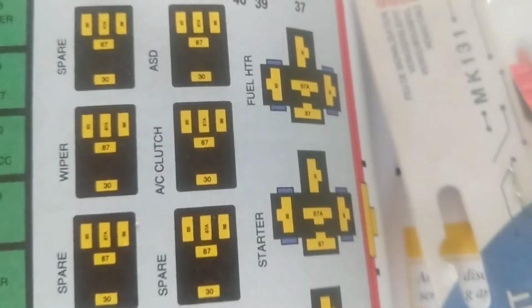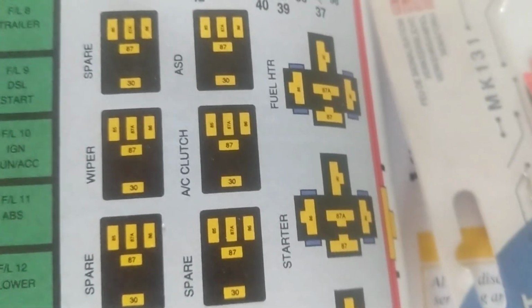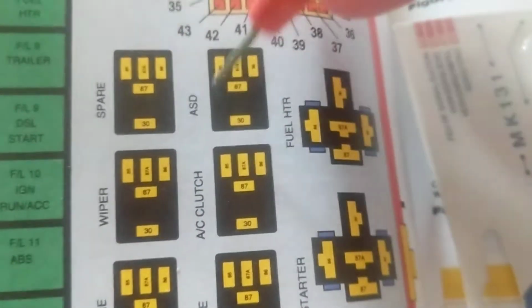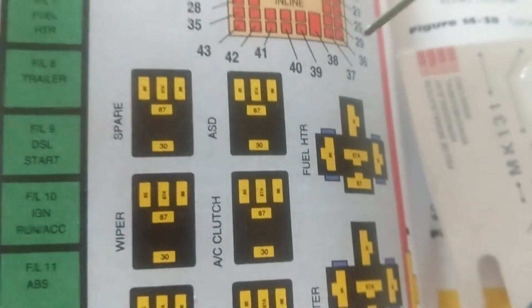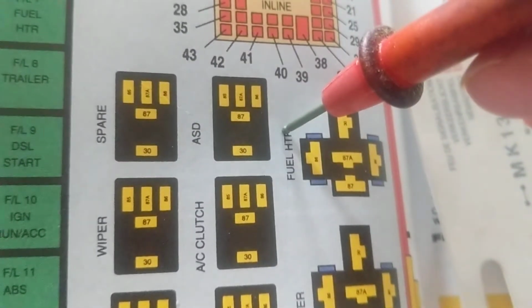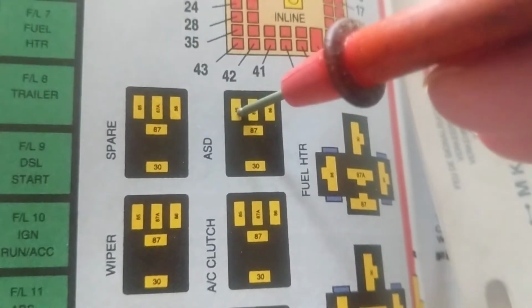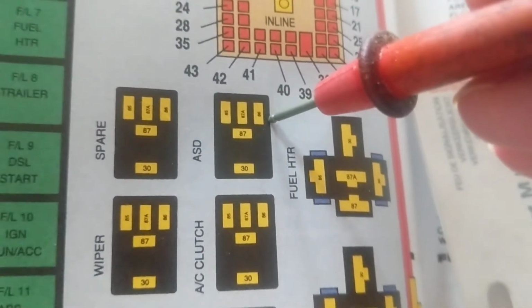I want to know how the components are activated when it's in circuit, like the video that I just made for you a couple of days ago, I believe. If I measure 11, remember, the relay without is going to measure 12 volts. So what? All that tells me is the fuse is good. When I have the relay inside, remember that 12 volts might drop. So it might be 11.7, 11.6 at this terminal of the relay. That's good. We want that.